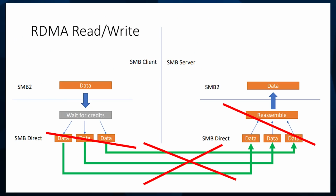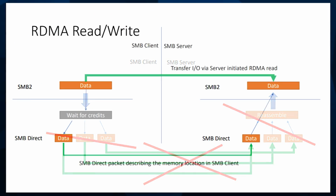And you can do that with a set of Intel P5800 Optane drives, because of the very low latency and very high throughput. I've got 2 P5800Xs, and they are screaming monsters on any platform that you use them on, Team Red or Team Blue. Looks like Team Blue is going to do some crazy stuff with Sapphire Rapids, but that level of performance with that relatively low CPU overhead is not currently possible in TrueNAS Scale. So my question is, can I get there? And can I get there with RDMA, Remote DMA? Because remember I mentioned the whole offloading thing. Remote DMA is something that Windows Server actually does well and has been really well supported. And interestingly enough, on the SMB client, RDMA is also supported.